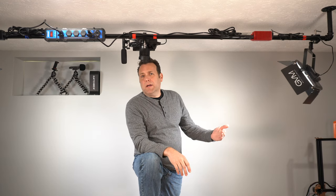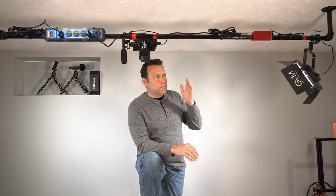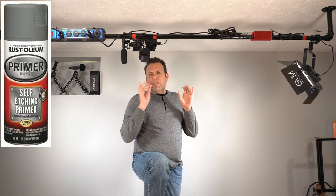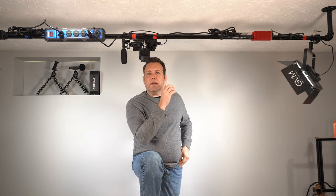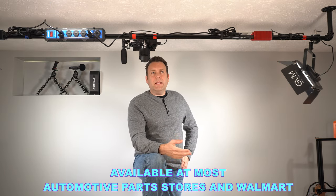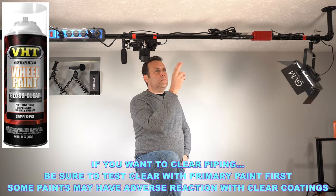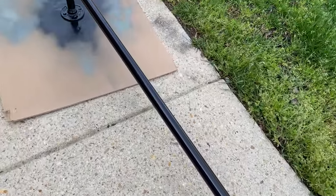As for the paint, the pipe comes painted with a standard black. I'm pretty particular about how things look, so I lightly sanded it — only took about seven or eight minutes. I put a very light dusting of self-etching primer that actually etches itself into the metal. You put just a very fine mist coat to start, then come back after that dries and give it a little bit better bond. Then I came in with black caliper paint, available at AutoZone or Advanced Auto. Caliper paint is a very durable black paint. I then applied a clear coat for mag wheels just to keep it from getting scratched — the clear coat is the more durable surface, a little harder and less prone to scratching and chipping.